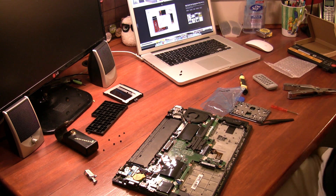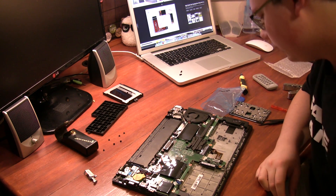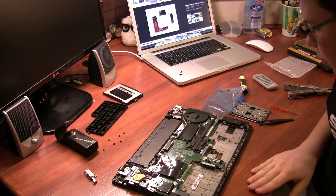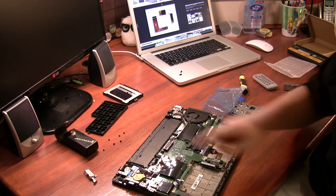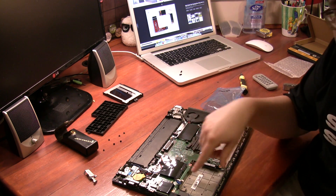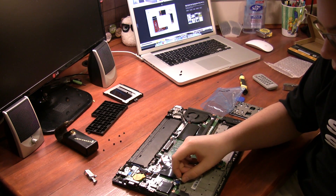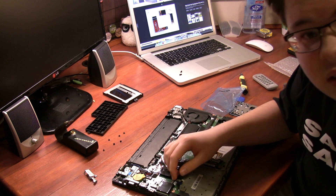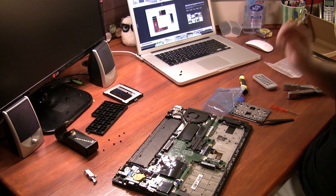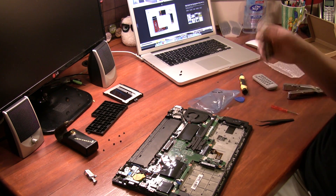The first thing you need to do is take out all of the screws on the motherboard that have an arrow pointed next to them. All of those screws are what hold the motherboard in. You take those out. The next thing you're going to need to do is take out a couple of connectors — depending on your computer. You're definitely going to need to take out the one that connects to the speakers. The other one, depending on your machine, if your computer is equipped with a fingerprint reader, you're going to need to take out that second connector as well. Finally, after you're done that, you can pivot the motherboard up and then get access to the screws that hold in your trackpad.